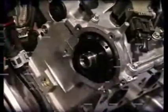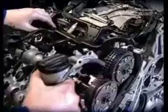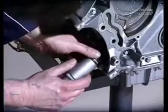Now take off the centrifugal lid. Afterwards take off the cylinder head covers. Caution: if the covers are damaged on removal, the complete cylinder head must be exchanged. Afterwards, unscrew the chain adjuster and renew it when installing.